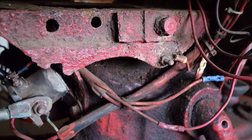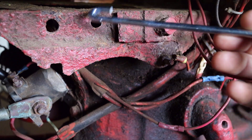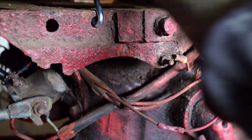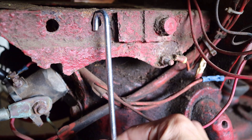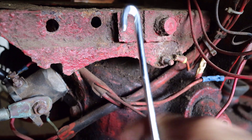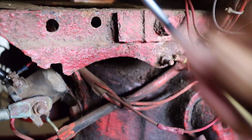The next thing I wanted to work on was holding down the battery. I bought a very simple kit because it was available at the auto parts store and I figured something would be better than nothing. It was really made for an automotive battery tray, which is almost the mirror image of this battery tray. The J shape in the hook cannot hook onto anything in this battery tray because the metal is bent downward rather than upward.